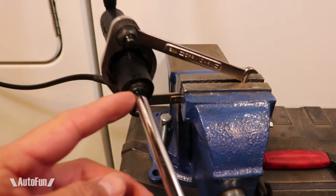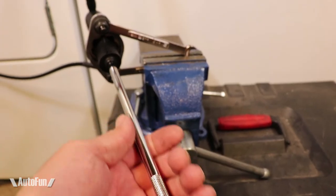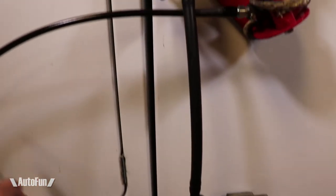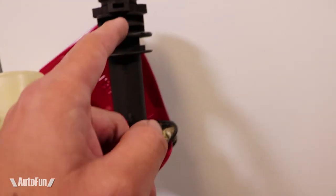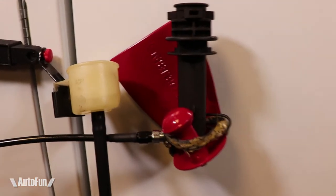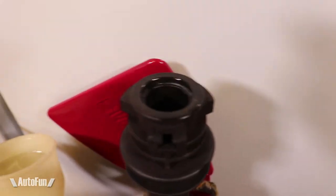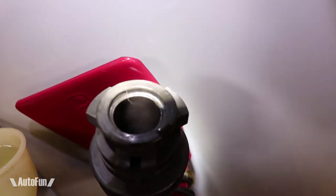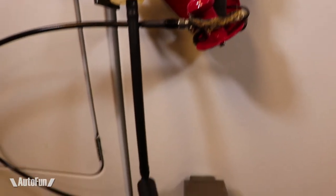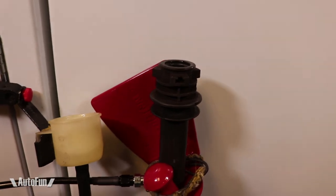I'm done with the pre-bleeding. All I did was use a small extension that fit in here and I depressed — basically pumping the clutch pedal — which sucks up the liquid. The hydraulic fluid fills up and the bubbles get displaced here. I had to play with the height of this so the fluid wouldn't come back down and refill the reservoir. Right now they're about the same height and there's fluid in the reservoir and in my temporary reservoir too. It took maybe half a dozen pumps to get all the bubbles out, and now this is entirely filled with fluid.